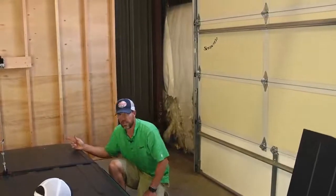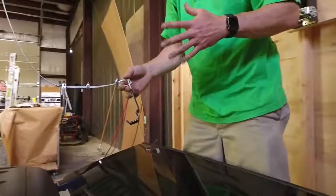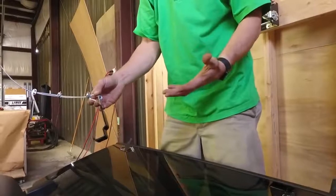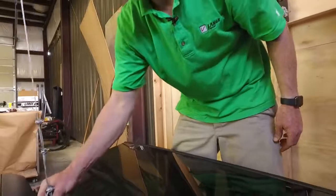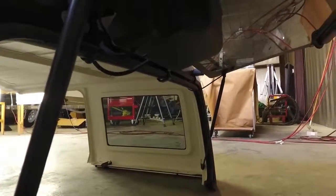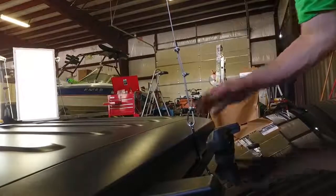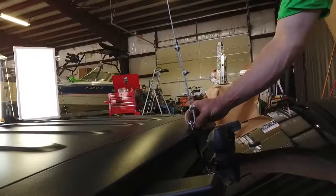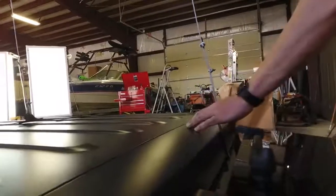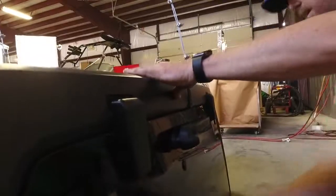For the rear, place the lifting hook between the top and the back of the window. The nice thing is you can lift your top with the rear window open, or close it and that works fine as well. Slip the hook in the back and line it up with the center raised panel — that's the dead center of the top. If the top is slightly askew when lifting, just move the hook slightly in the direction it's leaning. The rear window will close right over this patented bend hook, and you're ready to lift.